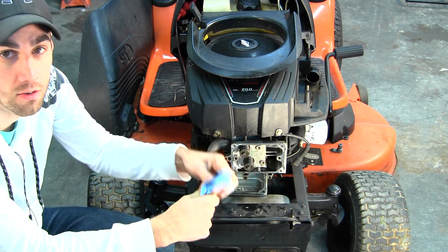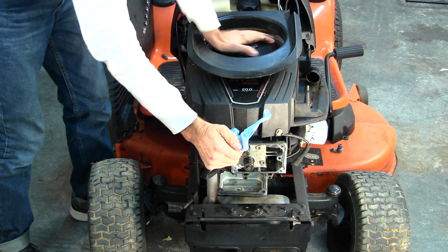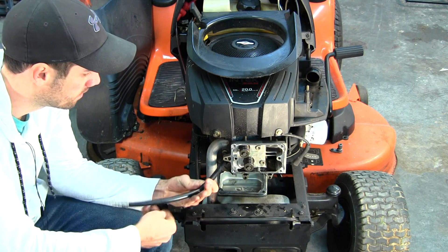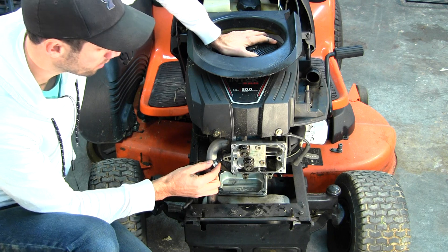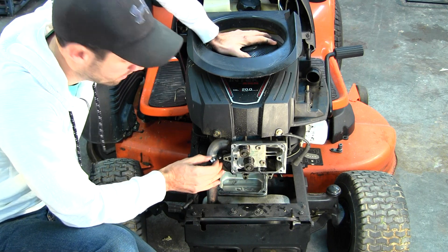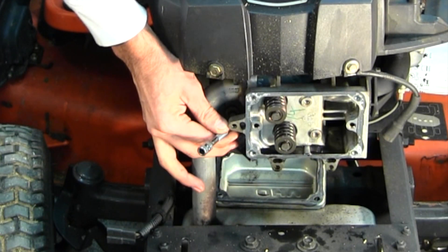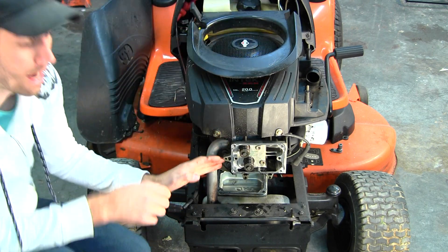All right, we've got our hose put up into one of the fingers of this glove. I'm going to hold this and turn the engine over. The glove has just blown up, which tells us the piston is coming up and building pressure. Now I remove the hose, insert the 1/4-inch extension, rest it on the piston, and turn the engine over real slow — guiding it carefully so it doesn't snag in the spark plug hole. I bring the extension all the way out as far as it will go before it starts going back down. That's about the highest point, which tells me the piston is at top dead center.